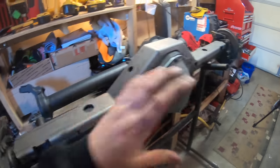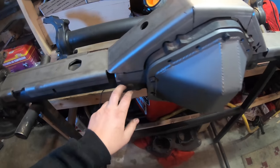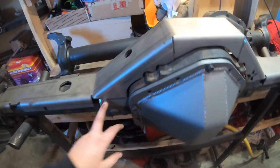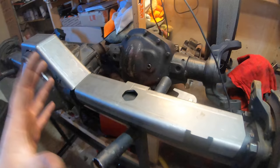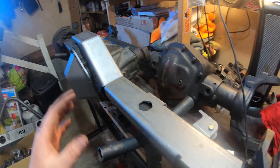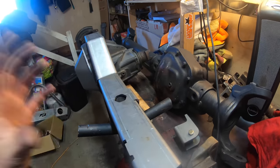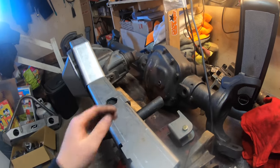So far to make this truss work, all we have to do is grind a little off the bracket, and I had to do a little bit off the diff — you might have to do it on both sides, I only had to do it on this side — to make it nice and centered. Now talking about centering, it's very easy to measure from both sides and get it perfectly centered. The big deal is getting this truss welded on with the proper pinion angle.